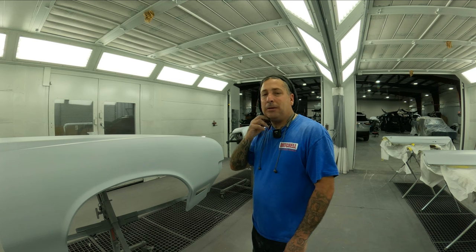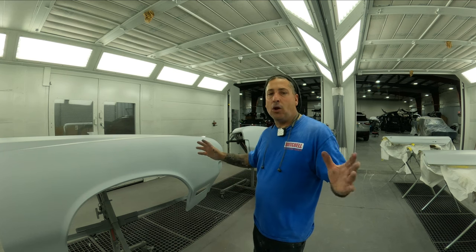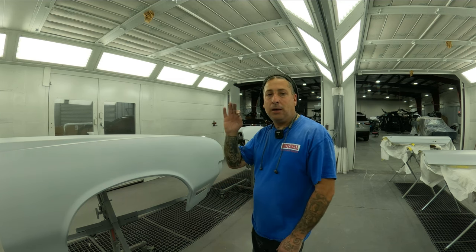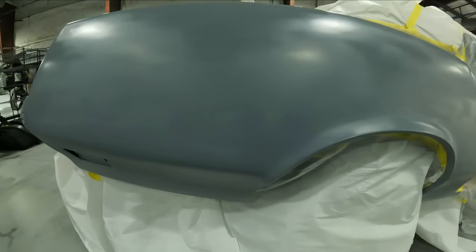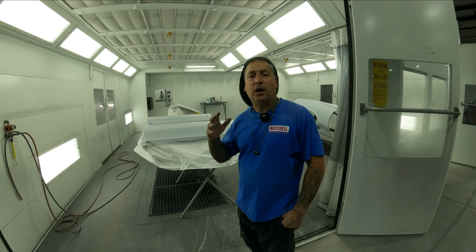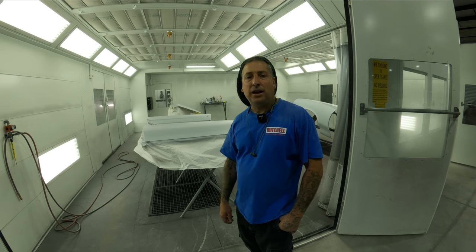We're going to be painting this one actually twice in a sense — not really putting the color down twice, but we're going to paint this vehicle all apart, then build the vehicle, knock it down with 600 grit, do all our stripes, and then double clear it. This thing is going to be beautiful when it's done. The quarter panel is all epoxy primed now so it can sit without any problems if I don't get on it right away. That's where we're at with the 72 Cutlass — this week we're going to start putting color on this vehicle. Make sure you hit subscribe and the bell so you're up on all these videos. This is going to be one you don't want to miss.